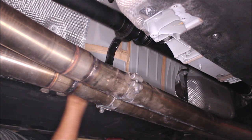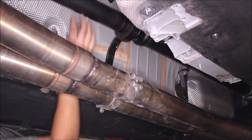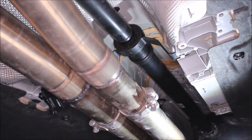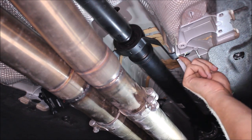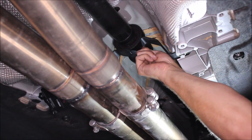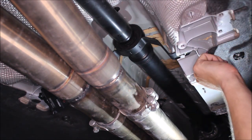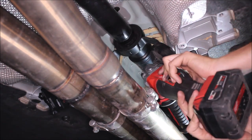Here's the movement of your center support bearing carrier. Now that we have access to the carrier, we need to cut the stock carrier off. It's easiest to keep it hooked up — don't unbolt it yet. We're going to make two cuts, one on the left and one on the right, going all the way through until we get up into the rubber. We've got to cut through two layers of steel here. Make sure you don't slip and hit your drive shaft — do not hit the drive shaft. Definitely wear proper PPE, eye and ear protection. These cuts can take a little bit.